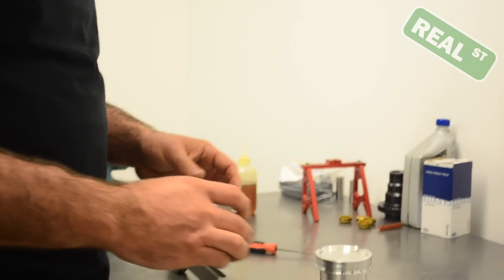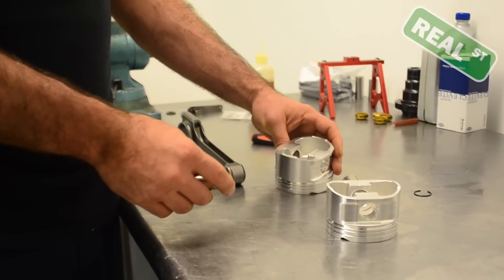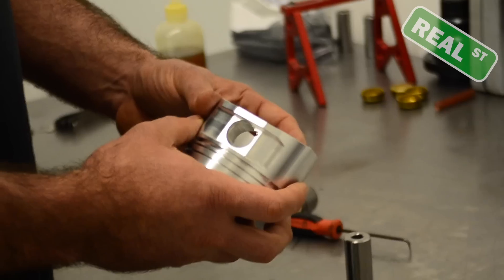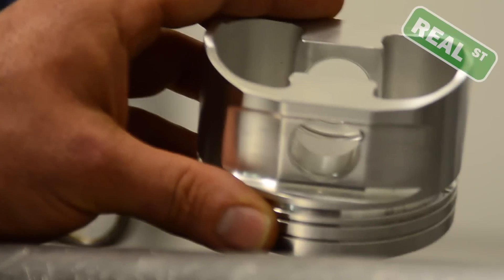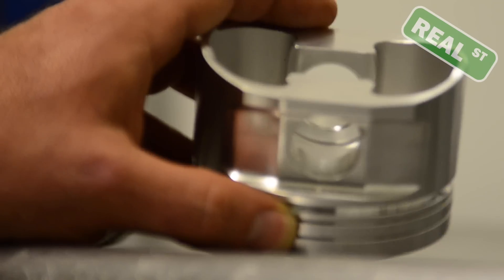It's just about having a clean, edge-free, burr-free, trash-free, debris-free assembly to ensure that you're not putting any material in these pin bores. You want to make sure the pin turns freely after it's assembled, because a very small piece of metal or a very small scratch in this pin bore can just perpetuate into a larger problem as the engine runs.